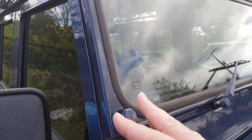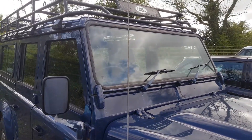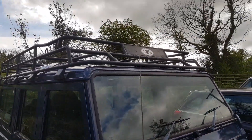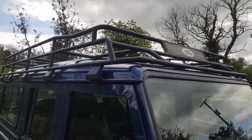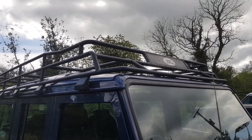Importantly, there's a wee bit of corrosion starting in around the back of this window seal, so I'll pull the window out and the seal out and repair and paint that. There's also a bit of corrosion up around the roof rack — he didn't know whether he's going to keep it or not, but I think it's a very good one and we'll be able to fix and tidy it all up.